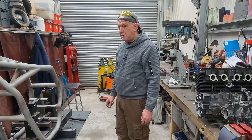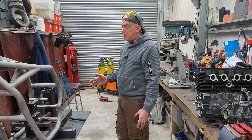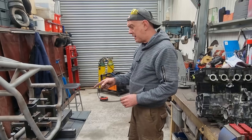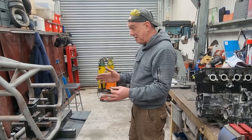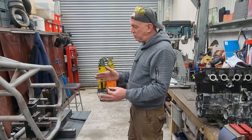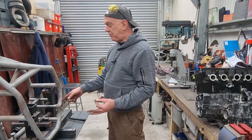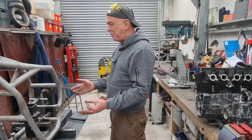I ain't got a Scooby why. I've had the mock-up engine in there and it all fits a treat, but that was knocking on it. So I've had to change things around a little bit. I put the mock-up engine back in, positioned it where I want it, and it is tight — it is probably tight. I could shift it up a little bit but I don't really want to, just to get a little bit more clearance because the frame sort of does that. I've got about 3mm clearance front and back from the engine cases hitting onto the frame. But clearance is clearance.